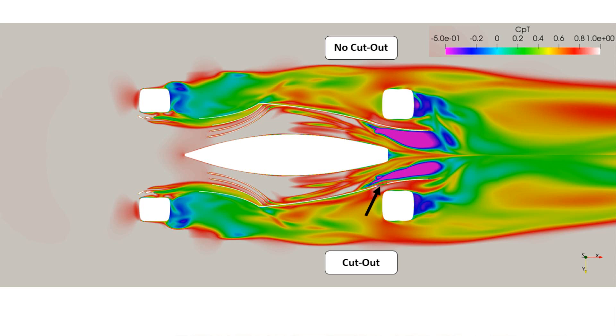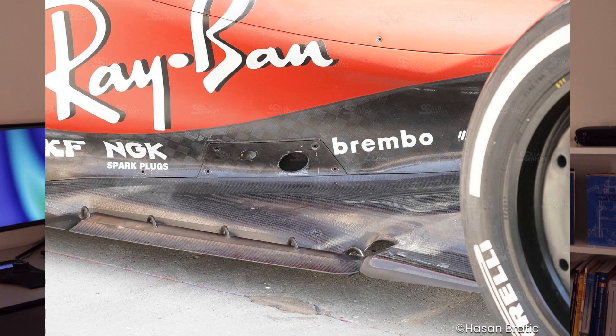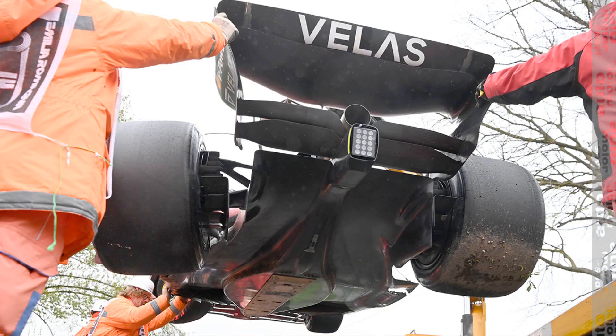Finally, slicing 50mm above the reference plane shows how the cutout adds mass flow to the system, even though there are leading edge alignment issues. I do guess that if the floor is high enough off the ground, vortex burst probably isn't an issue, and that probably means this device comes into its own for the medium and lower rear ride height range. But there are probably a bunch of ways you could deal with a floor edge vortex burst — for example, you could use multiple shedding edges and just adjust the general floor curvature to affect the pressure distribution.